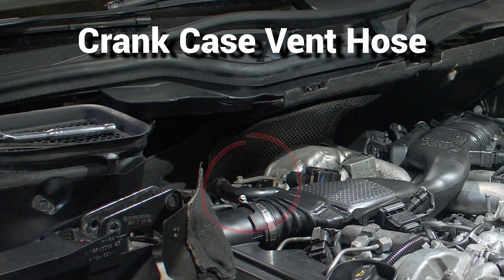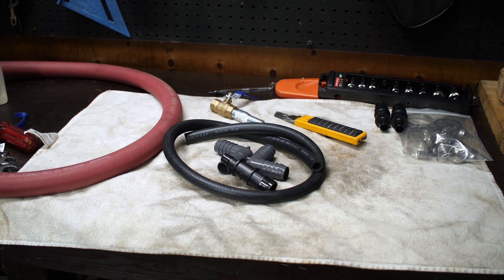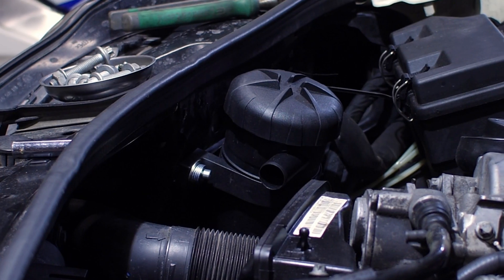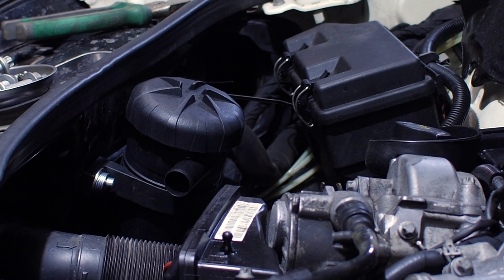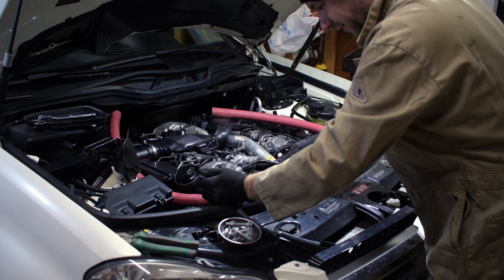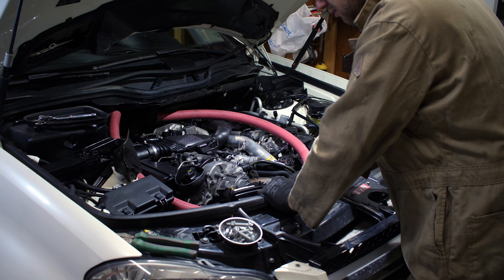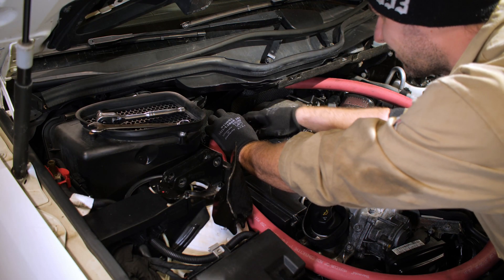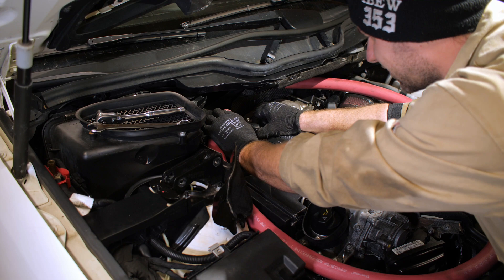The long and short of it is it's very simple, but we're trying to cut this hose in a good spot where we can route the catch can. The oil catch can is one inch inside diameter — it's quite large — and the crankcase ventilation hosing is 5/8 inside diameter. You're going to want a couple of couplers and a couple of 90s. Spend some time and really think it through. I felt it was a good idea to tuck those two 1-inch hoses next to the right-side air filter. You want those 90-degree 1-inch fittings because it's really tight up there trying to get that 5/8 hose and the 1-inch to meet up — definitely keep a couple of 90s on hand.